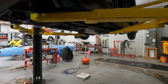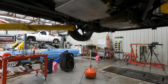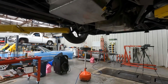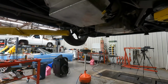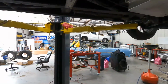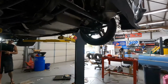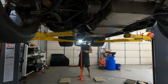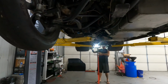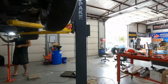So Sean's doing this. Last night, I pulled the transmission out and fixed a fitting that was leaking. Hopefully it was that fitting anyways. And then I flushed the transmission. It only had like 4 or 5 passes on it, and it didn't smell very good. So I'm kind of hoping it was a cross between old transmission fluid in the transmission cooler and maybe some old transmission fluid stuck in the converter from the last time. I don't know, but it's all brand new now. Shoved the transmission back up in there, filled it up. I think it was time to go home last night.